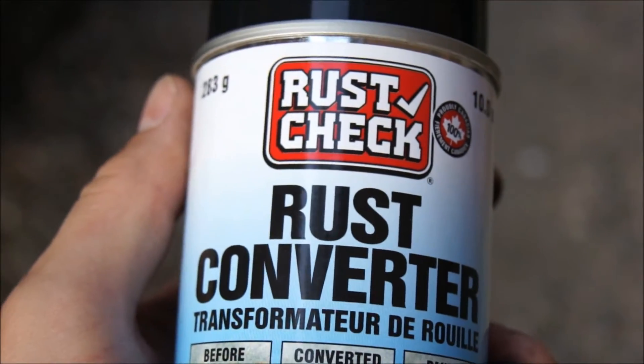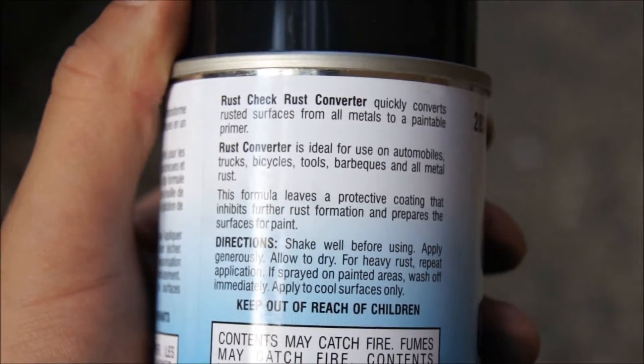There are a few more — there's a big patch right here. You can kind of see how it's down deep. What I'm going to do for those little holes is get some metal filler, smooth it out, and be good with it. For some of the holes I can't get that I missed — because I'm not perfect, I will miss some — like all these little dark spots, little rust things, I went out and bought myself some rust converter. I don't know if it works, but we'll see how she works.